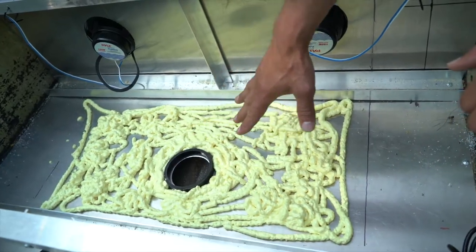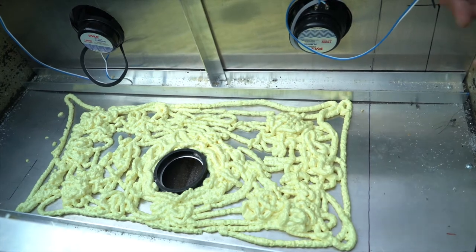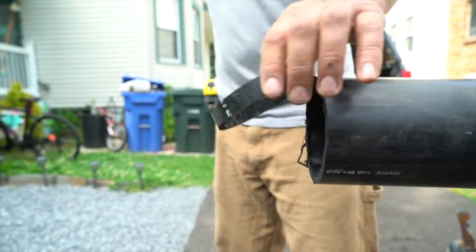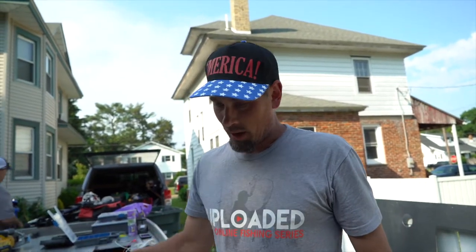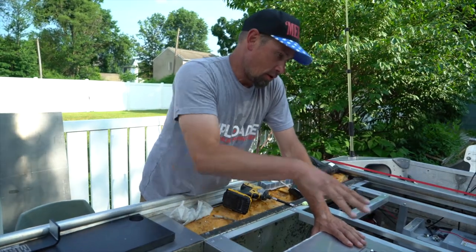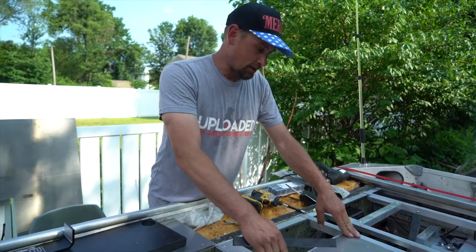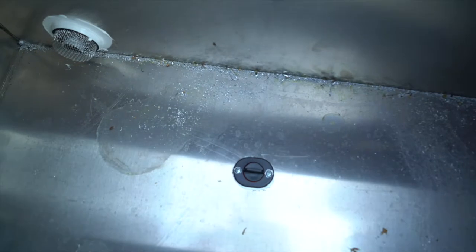So what we have here is a 3.5-inch hole through the deck down into the hull. We put a drain plug in the bottom of the live well. There's a pump out in the live well, but you always end up with about 10-20% of the water still in the live well. For that bit of slime and sludge and crawfish parts and shad guts and heads and tails and noses, we just pull that plug and that stuff will wash down into the bottom of the boat and slide out. So we put that bed of foam underneath the live well and drop the live well into place. We've got two PVC ABS hard plastic shims in there holding the live well in place. We got it flush with the top of the decking, and our drain plug is sitting right over top of that hole that goes down through the deck into the floor.